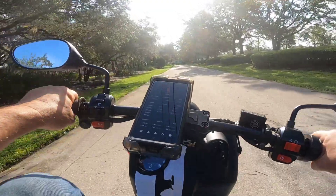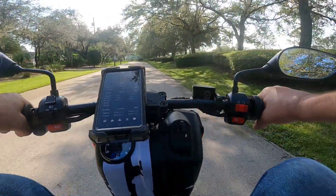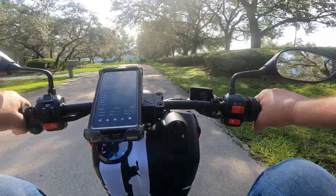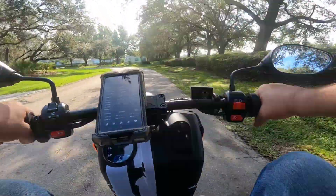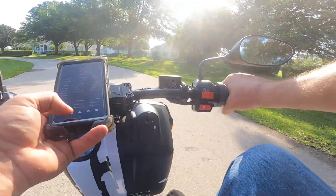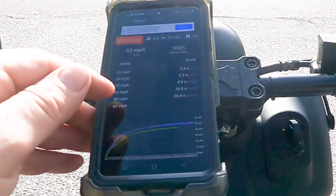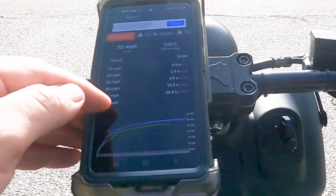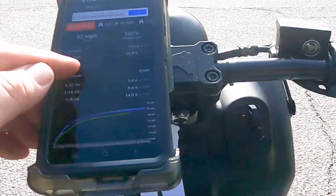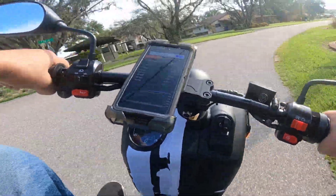This is not the carb tuning video — I just put that 110 jet in there to get this thing to run good so we can do the filter test. I just want to get the fastest of the three filter positions considering stock. That run was filter position one: top speed increased by one mile an hour, zero to 30 increased quite a bit — almost two seconds — and the eighth mile was exactly the same. It is an improvement, no matter how slight, so we'll keep it.